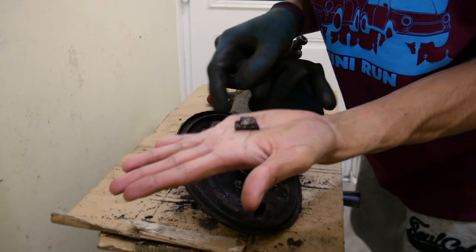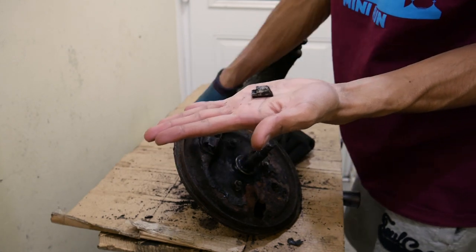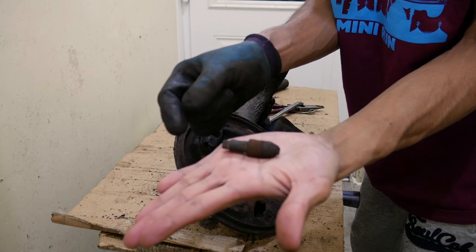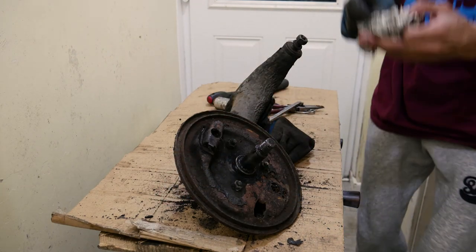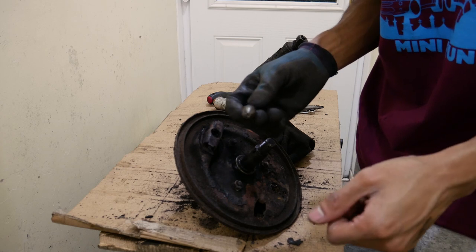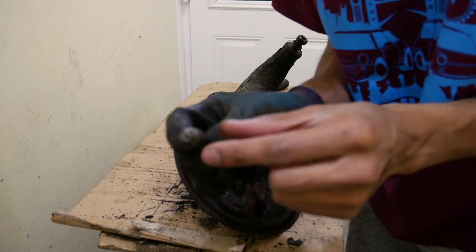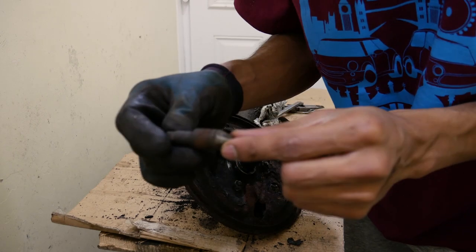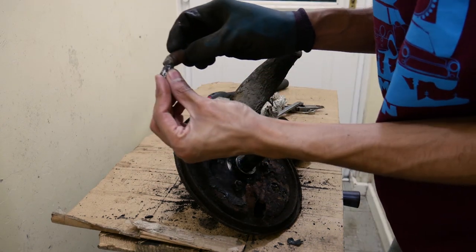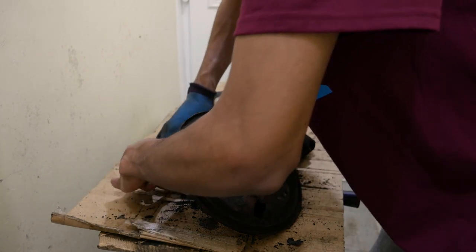On the cam you can see this side has a slope and this side has a 90-degree wedge cut out of it. The 90-degree wedge is what locks into the shoes and the slope runs on the cam itself. When you're tightening the handbrake it feels stiff-loose-stiff-loose — that's because the head has a cone shape with four flats on it. Each flat lands on the cam and as you wind it, it pushes to the next flat. The flats stop it undoing or tightening itself — it's a locking mechanism for setting the handbrake.